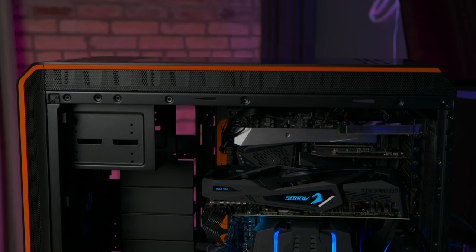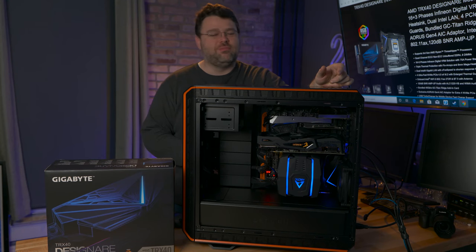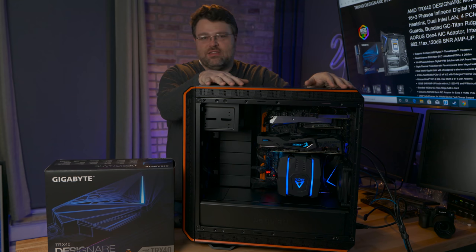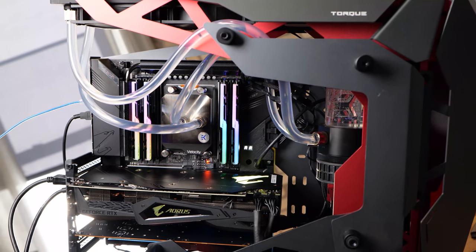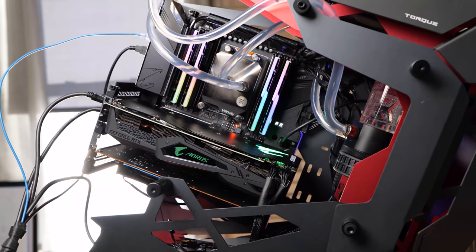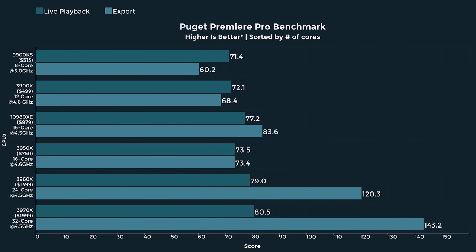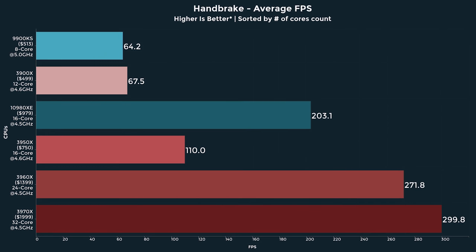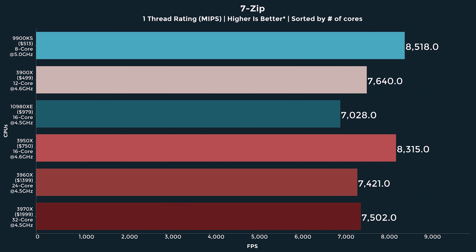It's solid performance. I've also flipped the motherboard upside down in this case, because the Dark Base lets you do that and you get more of a wind tunnel effect. For the bench testing, we used the same cooler — the custom loop — that we did with the other board. Overall, CPU performance on this motherboard was within one to two percent of all our other motherboards. When testing, you should turn off spread spectrum, because that can negatively impact your scores. Although it's good to have on for radio frequency interference and FCC compliance, set mine to 100MHz. You can claw back any performance deltas by setting your FSB to 101MHz.